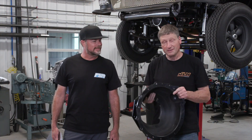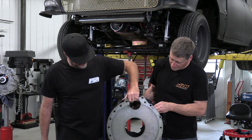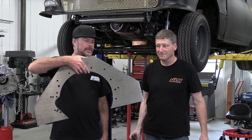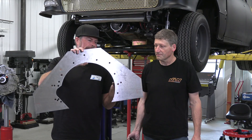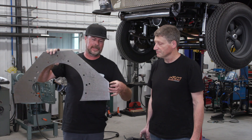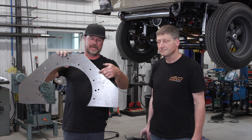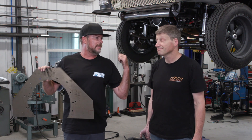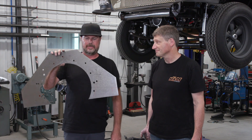With the transmission out along with the bell housing and old plate, they explain the plan. The old plate did a great job enclosing the clutch in the SFI bell housing for safety, but it doesn't bridge the gap between the frame rails and the transmission. The new plate from Applied Racing Products is 30 inches wide, with frame rails 34 inches apart. It provides two ears on each side to connect to tabs welded to the chassis, transferring engine torque through the dowel pins in the back of the block to the chassis.